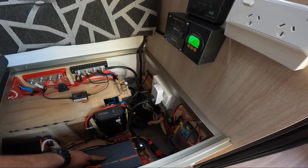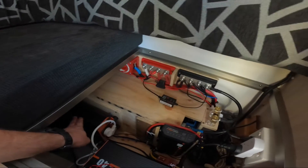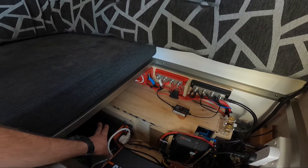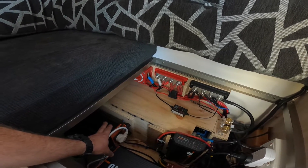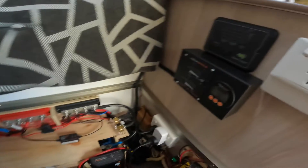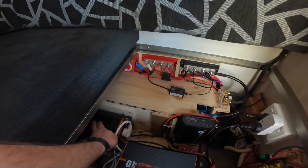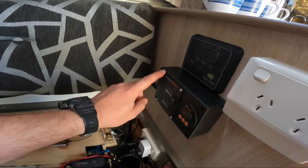That 240 outlet charges the AC charger, which charges the batteries directly. Under here I've got a 1,000 watt inverter. I know a lot of people are running far bigger inverters, but for us we don't need to run coffee machines and all sorts of stuff. 1,000 watts is big enough for us to charge camera batteries and laptop batteries and that sort of stuff — so that's plenty. We also bought the remote head unit, which basically lets you turn your inverter on without having to open up and switch things underneath the seat.